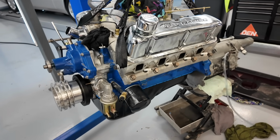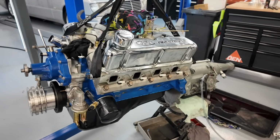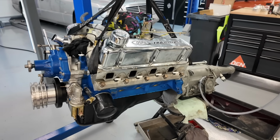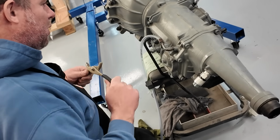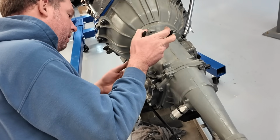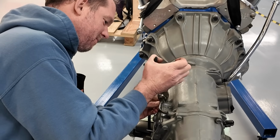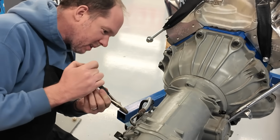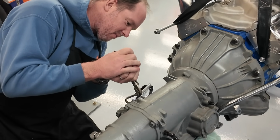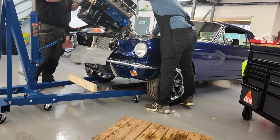Then we also suspected the sump gasket, because there was a little deformation of the sump where it meets its gasket, so we've smoothed that out, got a new gasket, and resealed all of that. We wanted to see whether the crank seal was leaking, so as a sensible precaution, after leaving the sump gasket to set the sealant, we filled it right up with oil and kind of upended it, initially making the mistake that we didn't realise the flywheel holes, or the flex plate holes, actually go all the way through the crank, which is not actually that common.